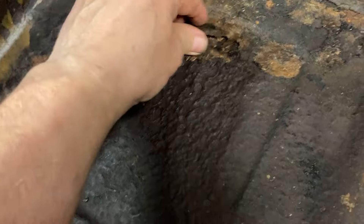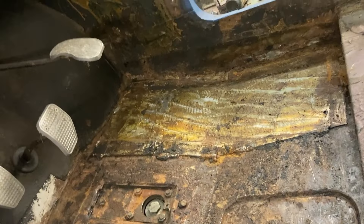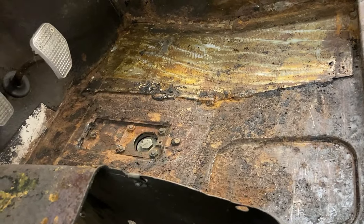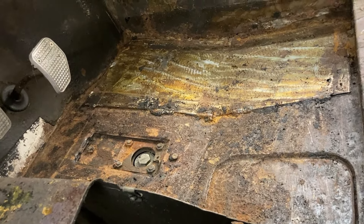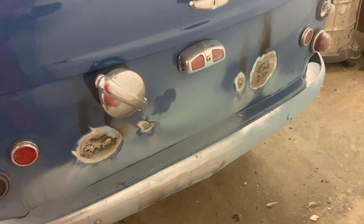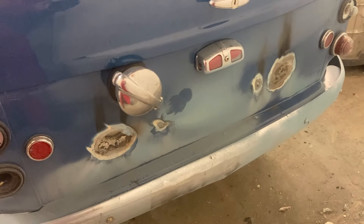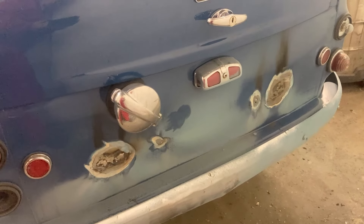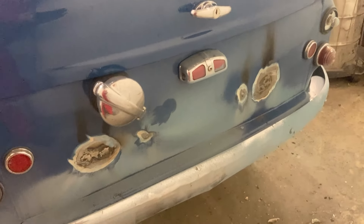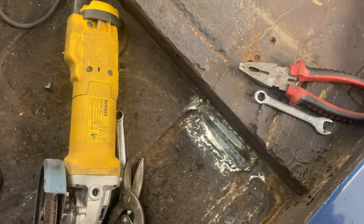There's glue — that's what's happening there. Yes, it's got that plate on the floor — we can deal with that. I've been welding up the holes in various places on the car. There's a fair bit of filler in the back panel for some reason, but I'm not going to lose any sleep over that. The floor hole has been welded up — I've made a plate and fitted that in.